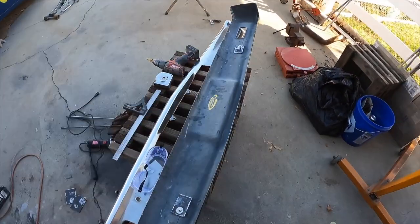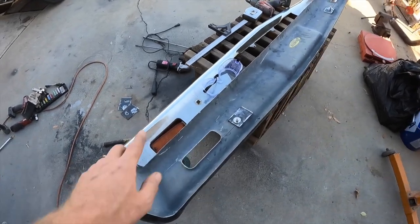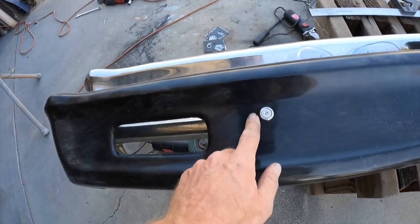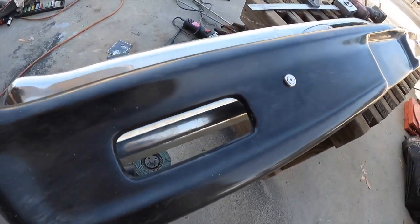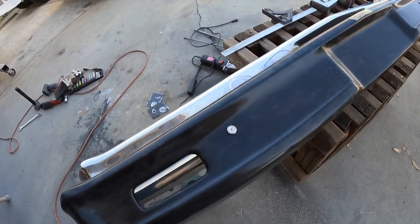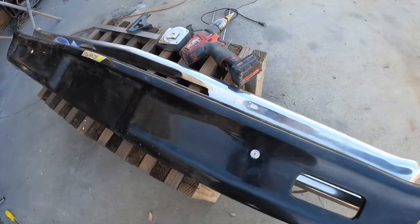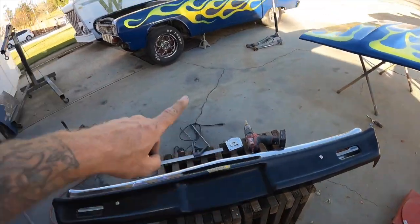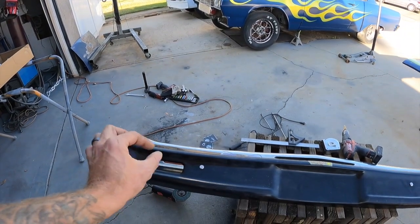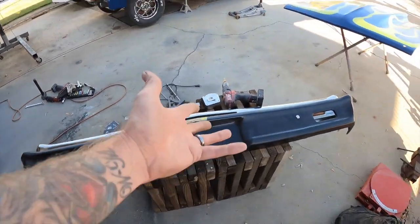I drilled a couple holes. This thing is really light duty so it's just some quarter-20 hardware. We'll probably put four mounting points — it doesn't weigh anything, so hopefully that's more than enough. These will back it and we got big washers. I thought these looked pretty cool — it's a little finishing piece with a countersunk head so it kind of looks like the original. I didn't want the ugly ones, so yeah, there's a washer behind it so they don't dig into the actual fiberglass. It's just for a finishing look. So I'm gonna tape this on, try to tape it in place, and then we've got our little mounts on the back. We just have to figure out the distance, and I've got some DOM tubing — three-eighths or so — and we'll span the distance. Once it's in place I can reinforce it and we have a bumper.